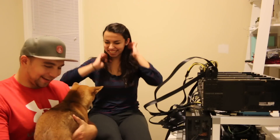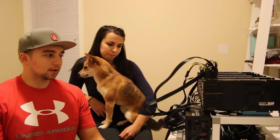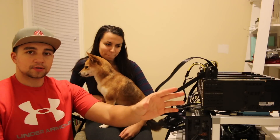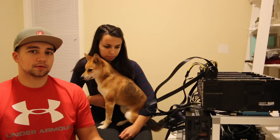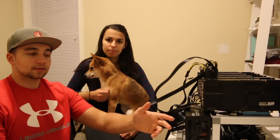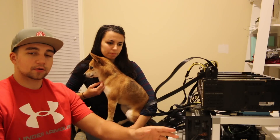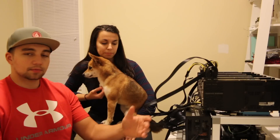This was a pretty straightforward, easy build. The frame makes it very easy — just two pieces that literally snap together. This is a great rig if it's one of the first you're going to build. The risers have obvious places to bolt and the holes are pre-drilled. Using an ATX power supply makes it simple, however a server PSU is always my recommendation since it's made for 100% uptime. Ideally I'd swap this 1000 watt GQ for a 1200 watt platinum server PSU from Parallel Miner with their Pico ATX adapter, which plugs into a PCIe power slot and lets you run the rig entirely off a server PSU.